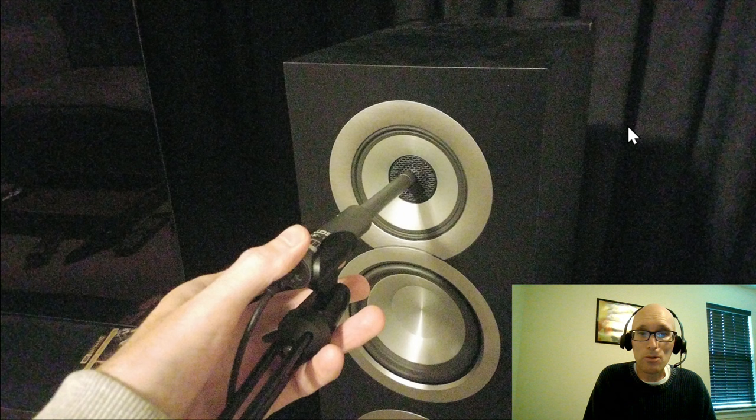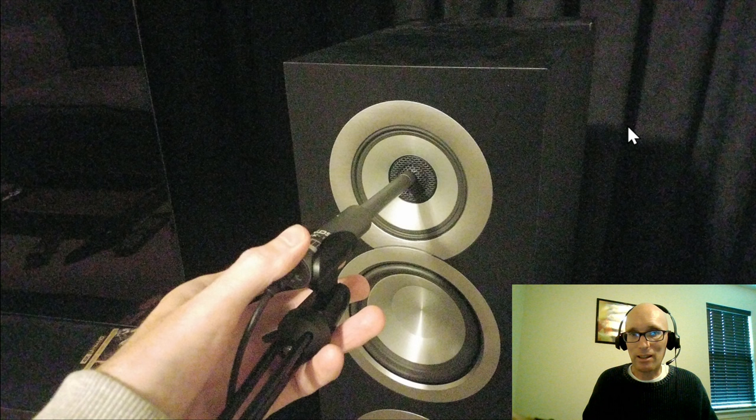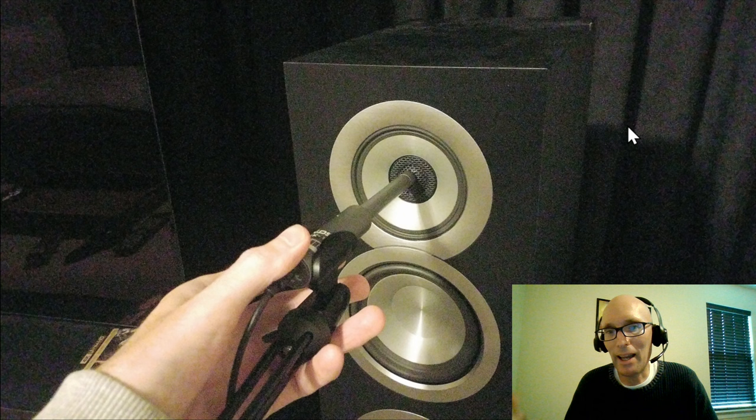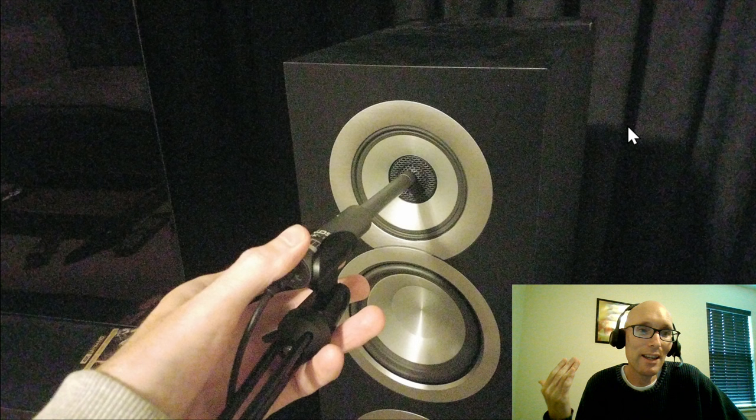two ways to control channel volume, or channel trims, and that is with the test tones on the actual receiver section itself, which are global. They affect every single input, and then there are input-based ones which only affect that input. So you should get everything to zero, flat, just to get an idea of what's happening with the speakers.